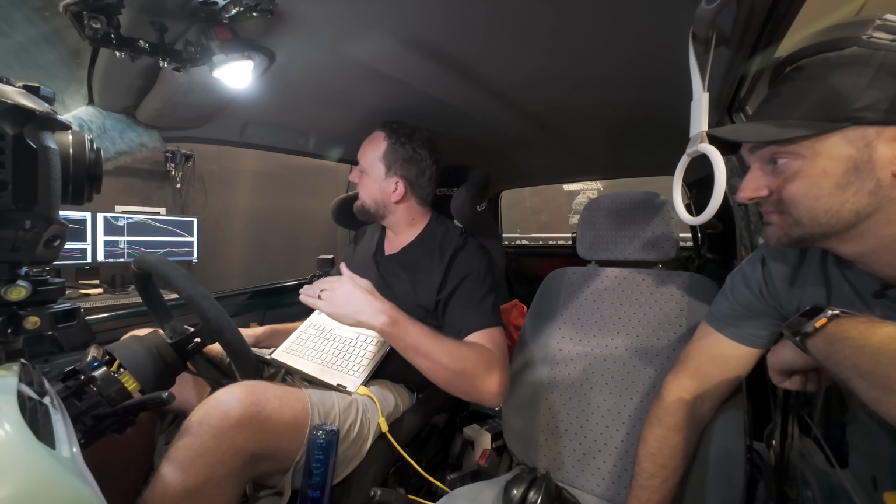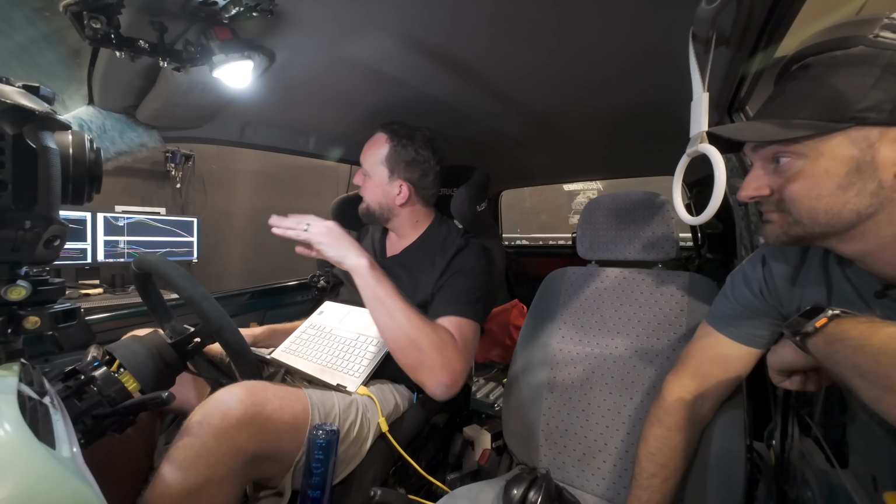It feels good, and all the mixtures are reporting, so everything's doing what it's told. We put timing in, we're drawing straight lines right on top of each other. Great. We're targeting different mixtures, our lines are dead flat, everything's working perfect, so love it, man.